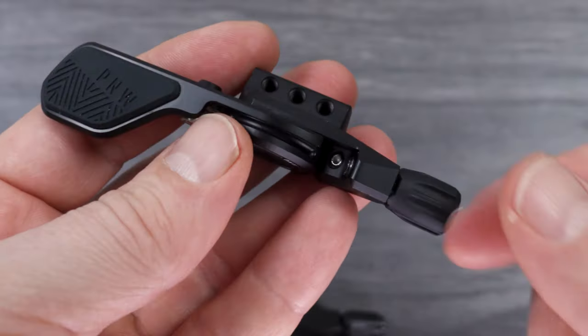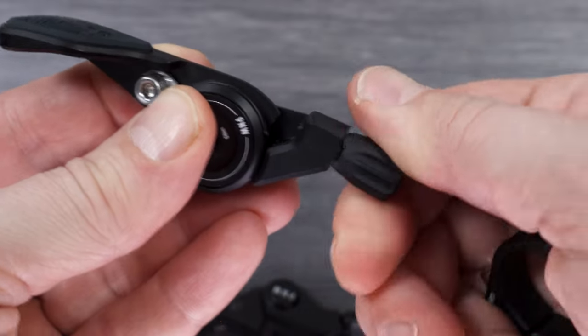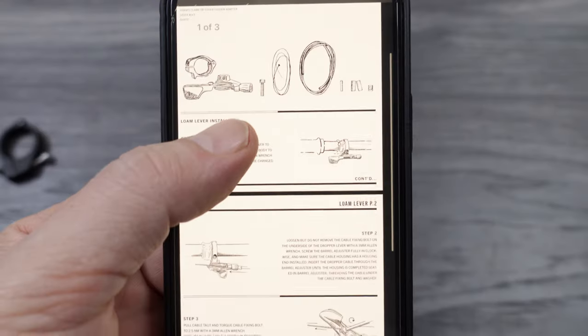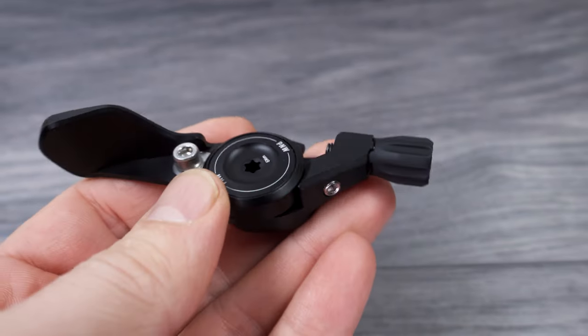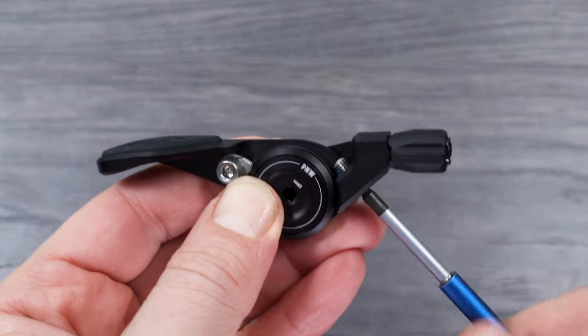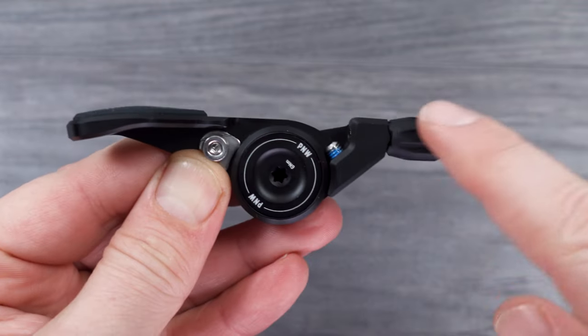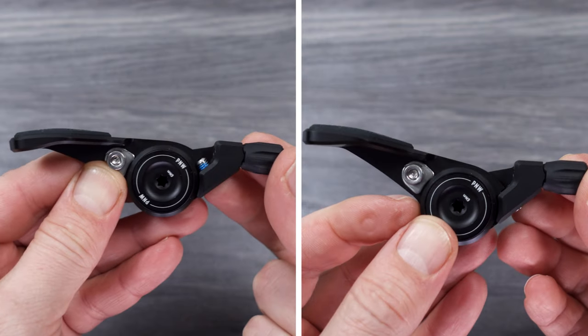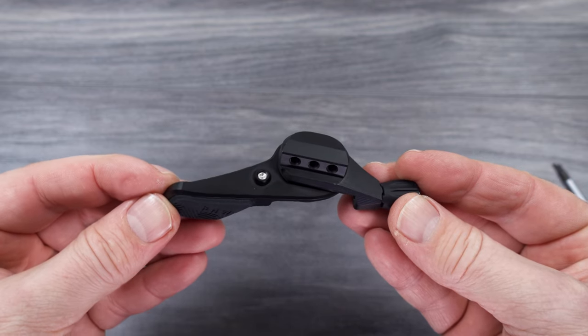You're going to need a 3mm allen key, and you do have the classic barrel adjuster at the end. The installation of a lever like this is fairly simple and clearly documented in their user manual, with the exception of the lever position set screw that they only talk about in the marketing materials. This already has Loctite on it. Look — the lever is now straight versus the original position. It all has to do with ergonomics and where your lever starts moving from.